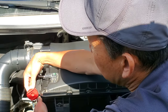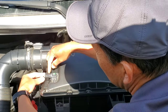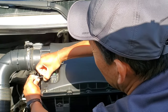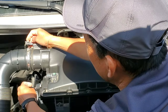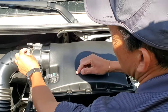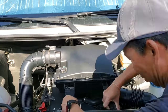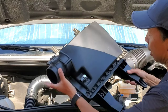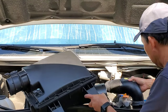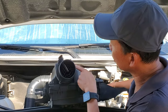Same thing right here — this is your battery positive terminal. There's a tab underneath; push it in and pop it out like that. Then your sensor cable right here — there's a little tab, press it and remove it. Same thing right here — press it and it comes right off. Now we need to take this part off. There — you can see I took this off; you can also pop this out. Now all we have to do is take these two screws off.